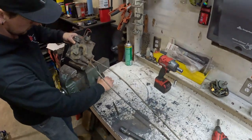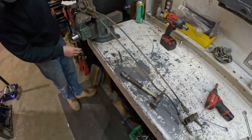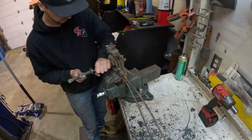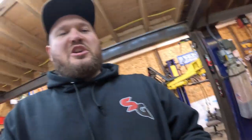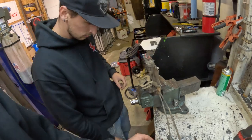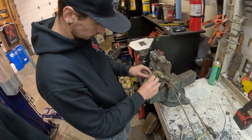Next up are the extended shift cables — forward and reverse shift cables. The original ones are too short now, so they need to weave through to a longer one. Nice thing is the kit comes with brand new ones; all we have to do is get them swapped over. We also couldn't get the forward/reverse switch off because it was rusted on there — that's a common thing — so we got a brand new one. Carlton's replacing that right now, and we're going to clean up that whole area as well.